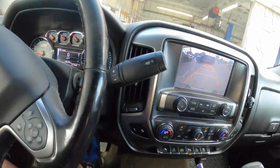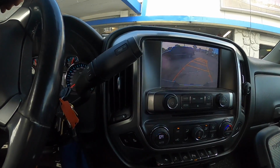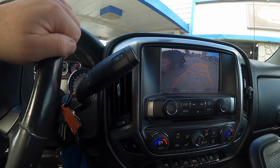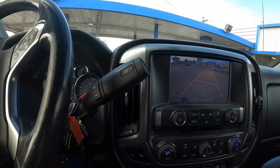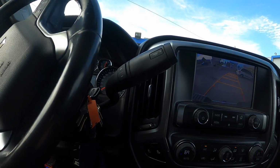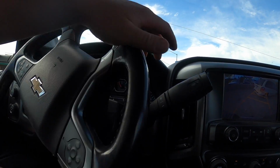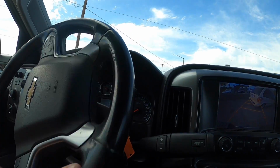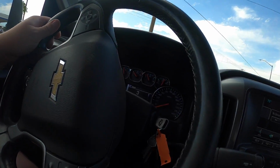Okay. This is a pretty nice truck, a 2015. It's unfortunate, one of the brake lines, when they lifted it, they had to pull the brake line, and they didn't bend it around the transmission cooler line, and it ate into the brake line. The tranny cooler line's not leaking, but the brake line burst. It just sucks. Yeah, that's scary.